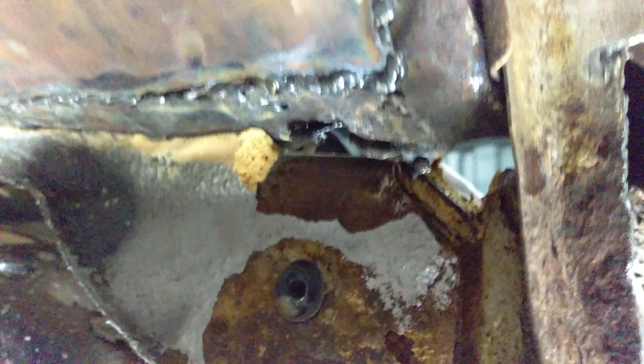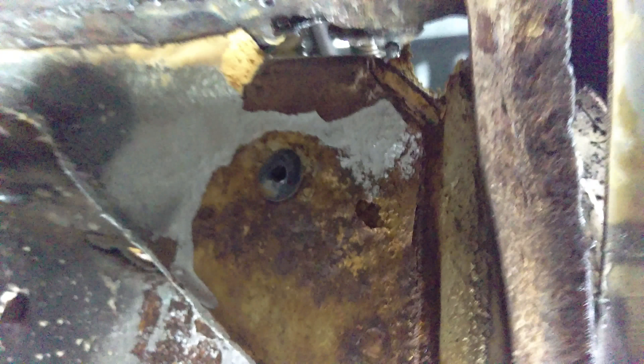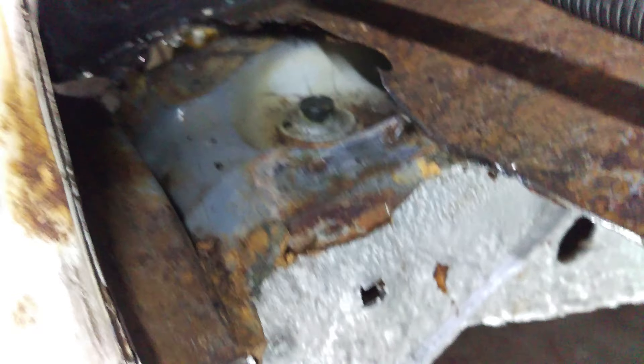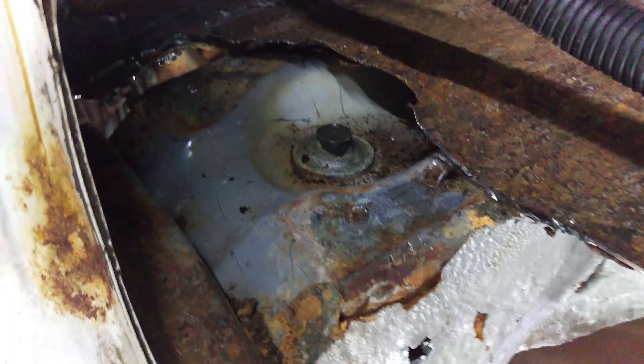The bed is jacked up so I can access the corners — that's just temporary. I've got another one waiting in California for me. This part I don't know what I'm gonna do about yet; I might cut out a square of regular steel or see what I can use from the donor. This whole thing is pretty solid so I really don't want to mess with it. I'll probably use vice grips, add some heat, and hopefully these will screw out so I can chase the threads.